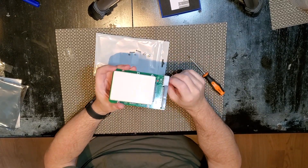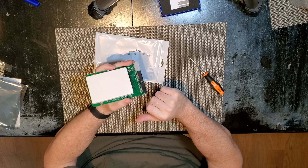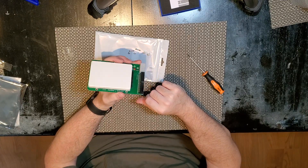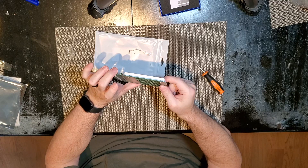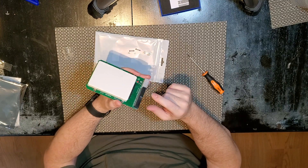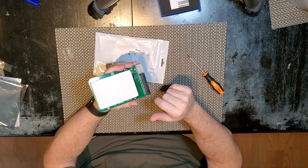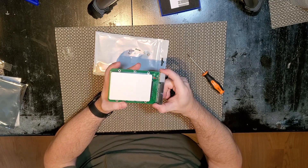Hopefully you found this at least a little bit interesting. This should be useful for a lot of retro machines that need IDE but you want to put an SSD in. The advantage of using an mSATA SSD rather than a CF card, SD card, or any other sort of flash like that is there's much superior wear leveling, even on a little SSD like this. It's also obviously going to be quite a bit faster — not that that really matters a ton for this particular application. But it has a lot better wear leveling, so if you put a swap partition — as we will do on this Ultra 10 — it will wear out much more slowly. Thanks for watching, please let me know what you think, and I hope to see you soon.